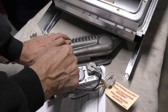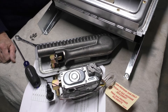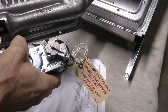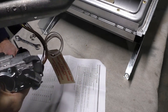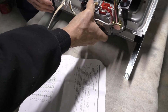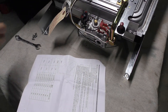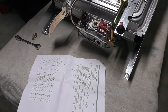Our box has an American flag on it and says made in USA, but the controller unit for the gas is made in Taiwan. This rope piece is the gasket — you have to take care not to damage it. The instructions say to remove it while doing this, but I don't see any reason for that; it would just add complexity and risk tearing it. It was really easy to fish the burner out once we figured out what was going on. Now we just drop it back in, replace the screws, and tighten up the one I loosened.